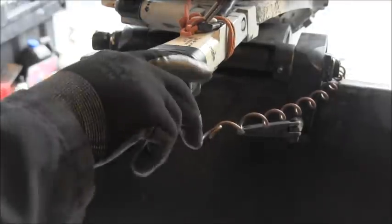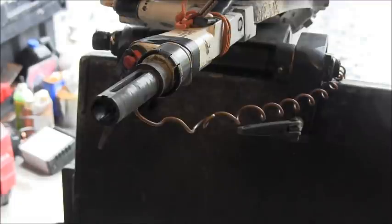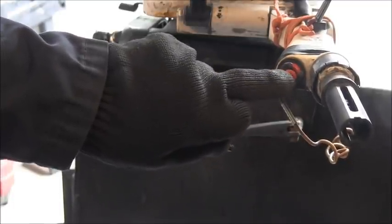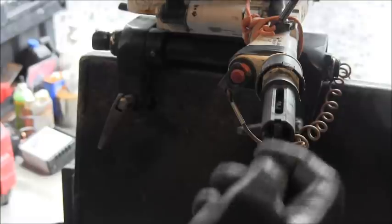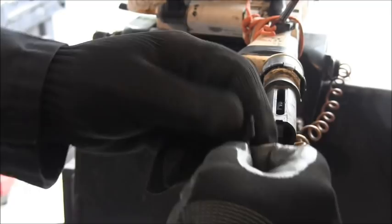When I would turn the throttle on this thing, it wouldn't advance very much on this cable here. So I got to looking in here, and what I found, I'll show you. This piece of handle here has been replaced, and it has the stop switch here. Well, this also was set up at one time. It looks like the actual grip had the screw part and had a man overboard switch out here, and this was left inside there. This broke off of that original MOB switch that would slide in there, and it was jammed all up in there.